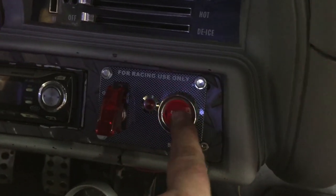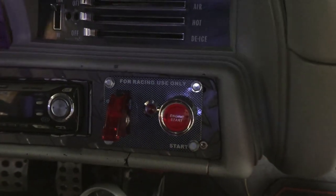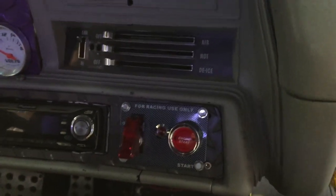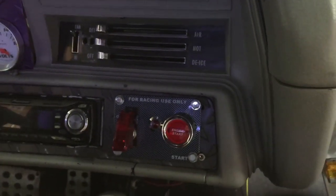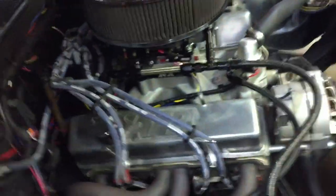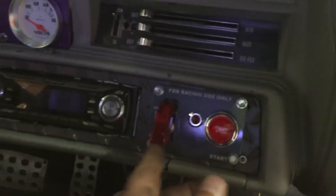I'll show you guys this: the activation switch is off, but look — purge still works. I was thinking I'd run my step retard off my full throttle switch so it won't activate until I arm it. But I got it wired into the hot side of the purge, so every time that fuse is in it activates that relay, and every time you close that circuit on the full throttle switch it's live even without the arming switch on for the solenoids.